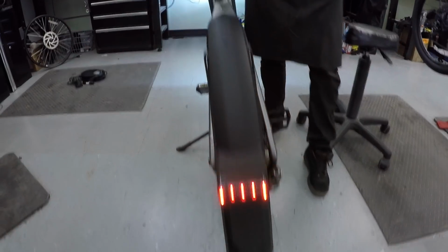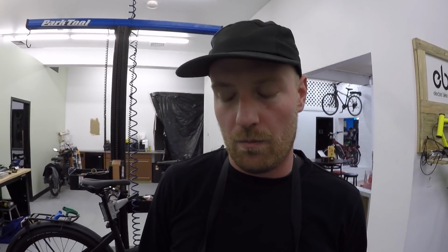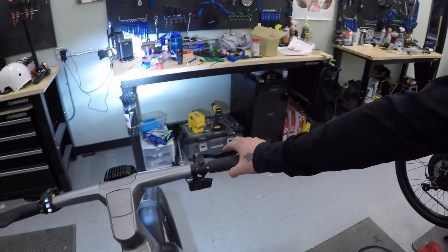Yes. The brakes activate. It does the 2-part thing: it illuminates the back, but also on a Stromer, you can set it to drag on the rear motor. It has an engine brake built into it. Like the recoup thing that they do? Correct, where you automatically recharge it. When I ride my Stromer, I like it because if you pull the lever just partially, it'll engage the motor but not touch your brake pads. So you actually never really use brake pads on these things. It's great. Makes them last.